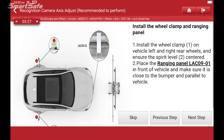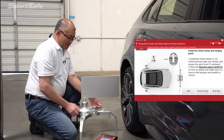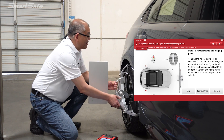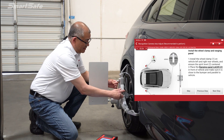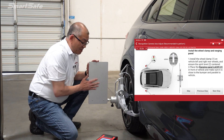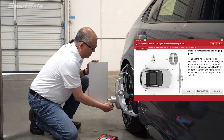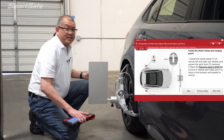The next step is to install the rear wheel clamps — we'll be doing this on both rear wheels. You simply place it on the tire, check the bubble indicator to make sure it's level, give it a snug tighten, and the main thing is to make sure this panel is parallel. We have another bubble indicator located right here, and we'll line that up, then repeat this on the other side.